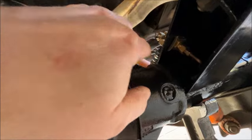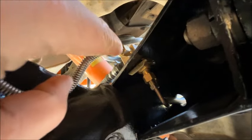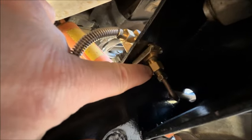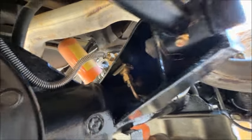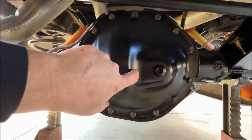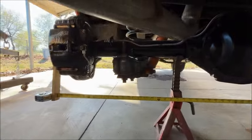At this distribution block — that's the factory HO52 brass distribution block — you're going to have to run a fitting to go between the three-sixteenths and step it up to quarter-inch tube, which is actually I think seven-sixteenths thread. Here's a fitting going between the three-sixteenths tube nut and the distribution block. I also put a later model cover on it — the 90s covers don't have a fill plug here, so I just got one on the side. Very nice setup.